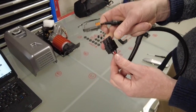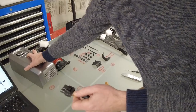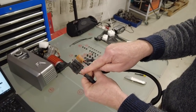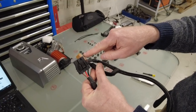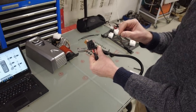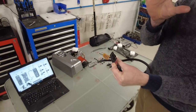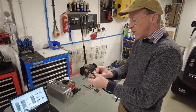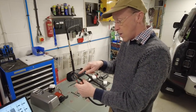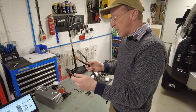Normally that would go to the cigarette lighter or auxiliary power outlet. But the brown wire goes all the way into the control module which is mounted on the back of here. What happens is when the compressor is in use, it doesn't give any power out to the power outlet — so it doesn't want you using the compressor and the power outlet together because you could overload and blow a fuse. A contributor mentioned his fuse keeps blowing when he uses his compressor, and Land Rover told him not to use the power outlet at the same time.